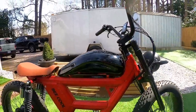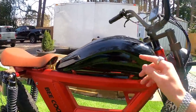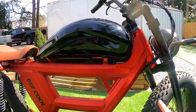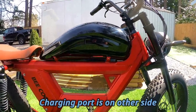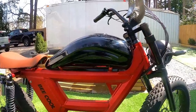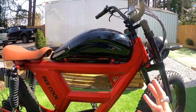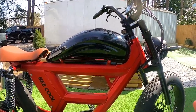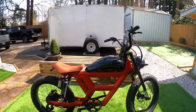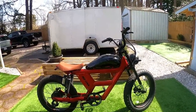For the battery pack on the Challenger, it's a 48-volt 30 amp-hour pack hidden behind the fake plastic gas tank. The plastic tank is two parts held together by about 16 tiny screws. I tried to take it apart and couldn't get to all the screws. This is an important thing to recognize: the battery is non-removable. You are not taking the battery off this bike without completely dismantling the whole tank. You'll need to store this bike somewhere temperature-controlled — a garage or heated and cooled space.